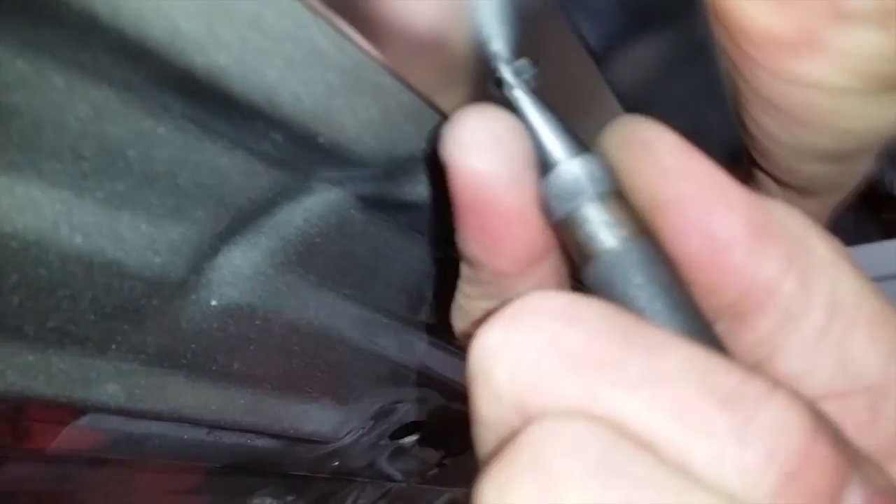So the hole that needs to be drilled — you simply go up in here and find about the center point in the slot. Make sure this is all the way up against the hood. Now there's a little dimple in there somewhere, and that's where you drill out.